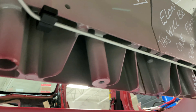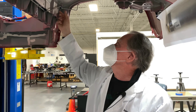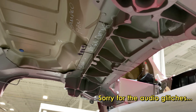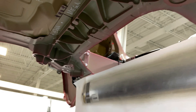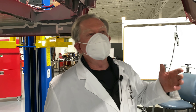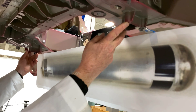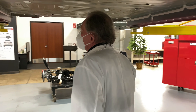Little casting features don't cost much money but make it so much simpler to include snap fits for brake lines and other wiring on the other side of the casting. We also found an anomaly — these castings have no tapped holes, nothing. Tesla may be considering an air suspension system instead of springs, which would require a tank to hold air. These locations right here might be where a bottle or tank would mount.